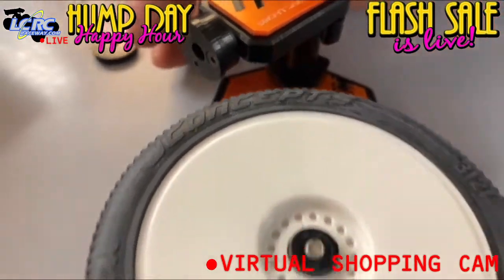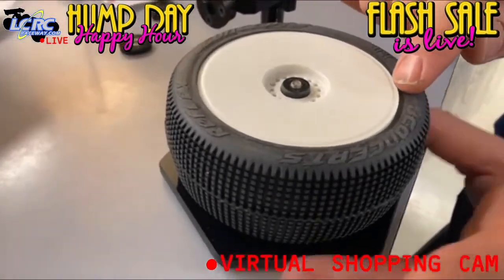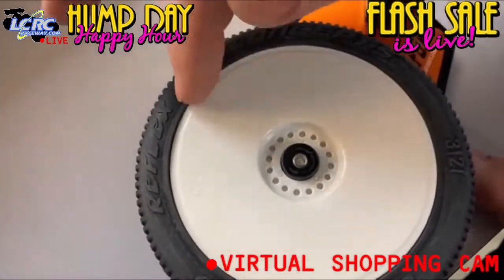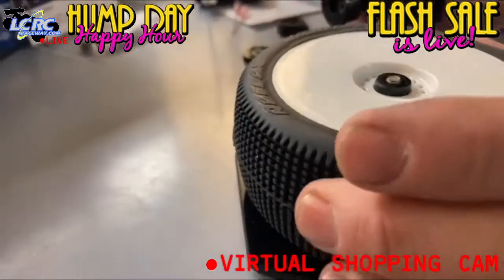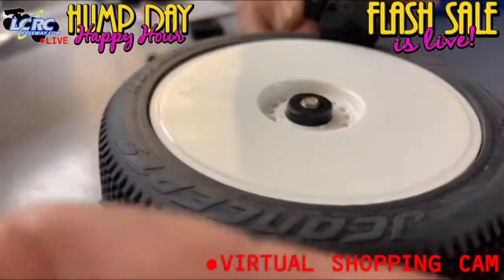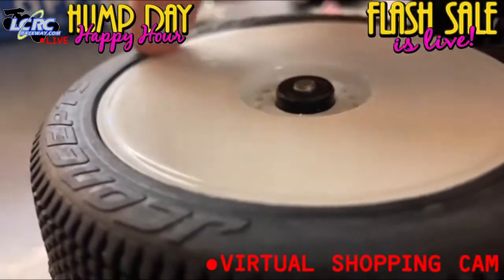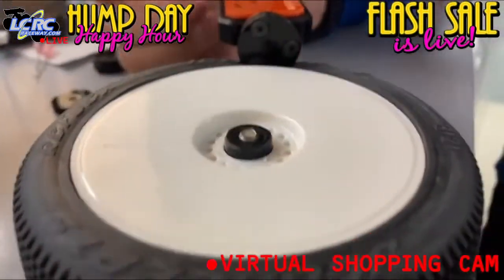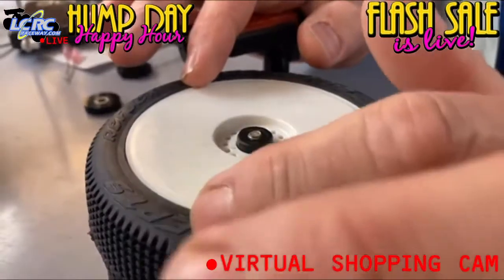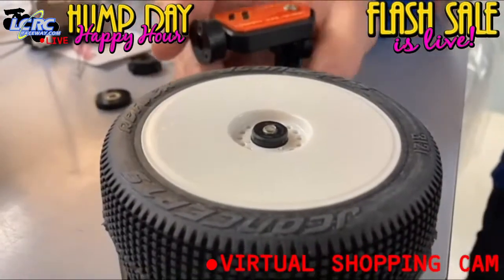The thing I don't care for, now I get it that I've hastily spun this thing around a couple times, but over here, the bead of the tire is too far in. Over here, it's too far out. Hold on, let me see if I, oh, well, you fixed it now. Well, yeah, I fixed it. I'm OCD like that. So, spinning it around, like here, you can see how it's high, like there, you can watch me push it down. I'm not saying that you can't be effective gluing tires with this thing. You'll just have to have your A game on when you first run the first bead of glue around it. You better be pushing that down if you want to have it perfect.